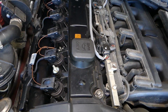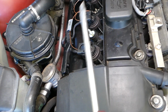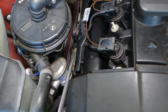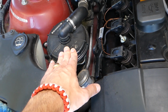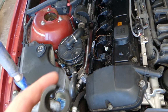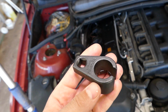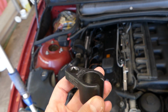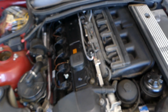Now what we're looking at now is we need to find sensor 1, bank 1. So that will be, guys, the oxygen sensor right here, this oxygen sensor. In order to remove it, if you have a secondary air pump, not all BMWs will have that, depending on where you live, you need to remove that, and we'll be using that socket. Now all the tools, including the socket and the replacement oxygen sensor, will be listed, guys, in the description of the video below for your convenience. So please do check it out, quite a bit of helpful information, and it shows you where we get all our parts from.